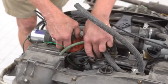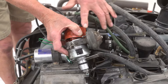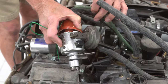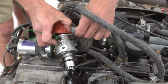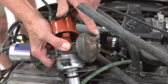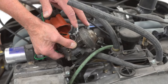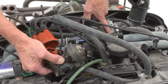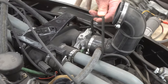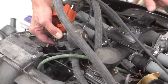Next, we have the distributor. I've pulled this distributor out to show you that the vacuum advance has two lines. The larger one coming out of the side is for the retard — the vacuum retard — which actually pulls the timing down to zero. The one sticking up in the air is for the vacuum advance. When the distributor is in, the retard is in the front and the advance is in the rear. On the throttle body the retard is also in the front and the advance in the rear. The advance is a 3.5 line and the retard is a 4.5 line, so it's easy — front-to-front, rear-to-rear, can't go wrong.